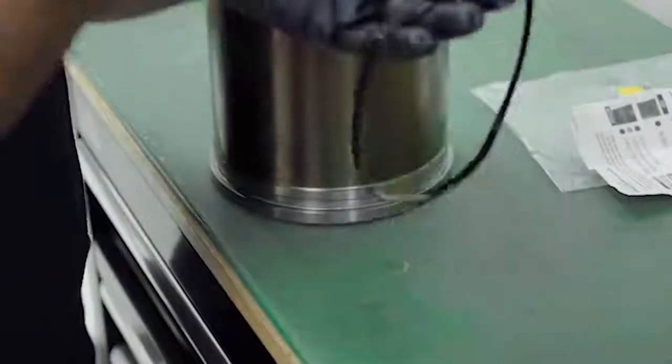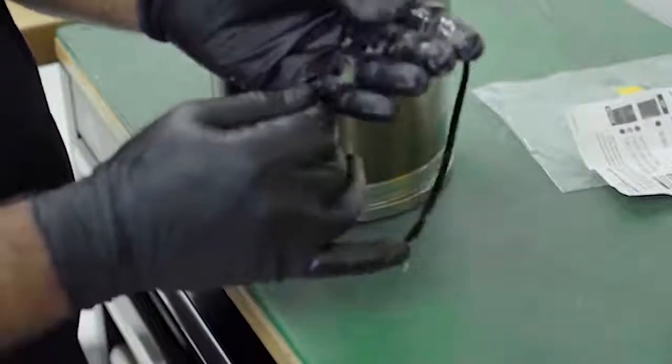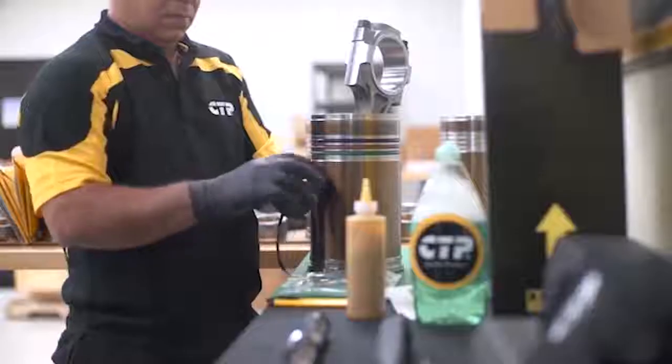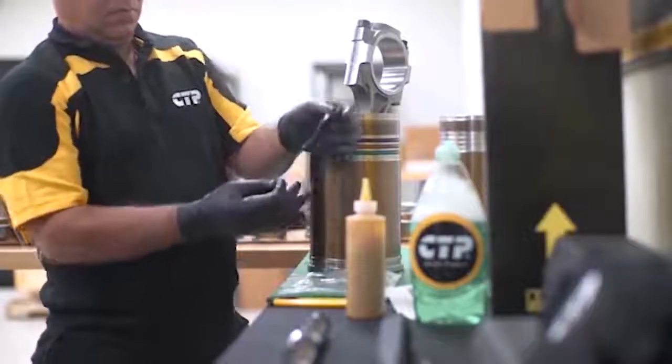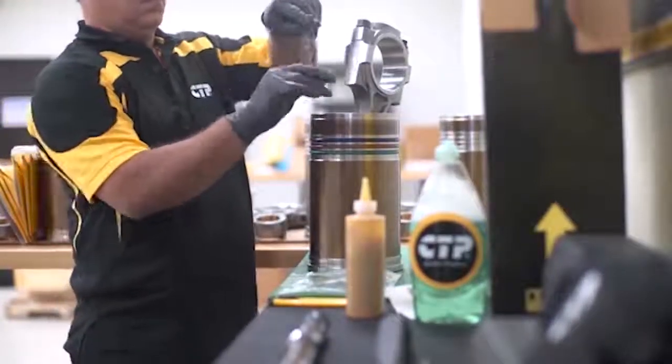The seal set also includes a band seal. This seal goes on a special wide groove just under the liner flange. The technician applies a generous amount of engine assembly lubricant to the band seal. The sealing bands swell and expand after coming into contact with the petroleum lubricant. This is purposely designed in order to form a tight seal on the block. Therefore, the lubricant should only be applied just prior to inserting the liner into the cylinder block.